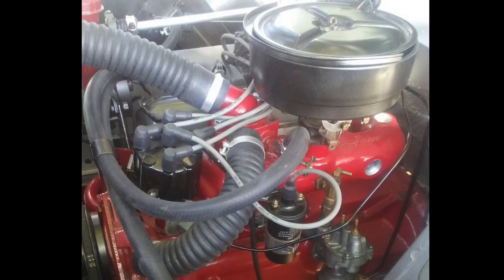One drawback to this design — and there were a number — was the coarseness of the engine, especially the 196-cubic-inch four-cylinder. Four-cylinders are inherently imbalanced, and the larger they get, the more their secondary vibrations tend to show. Some of this coarseness may have been more acceptable in a truck-like vehicle like the Scout compared to the 1961 Tempest, and International certainly didn't have the Tempest's rope drive to help smooth out some of the engine's vibrations.